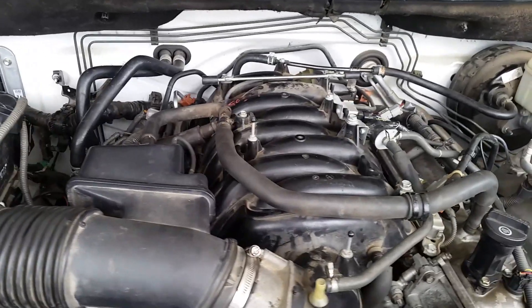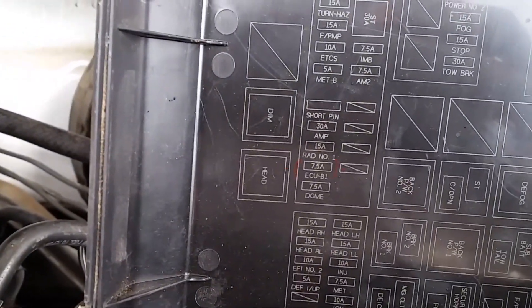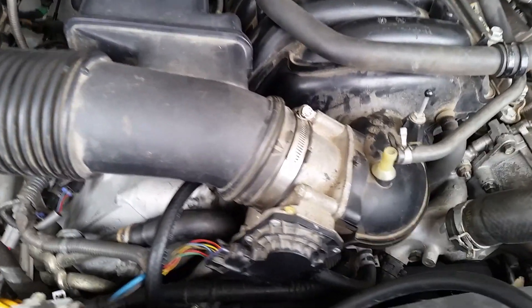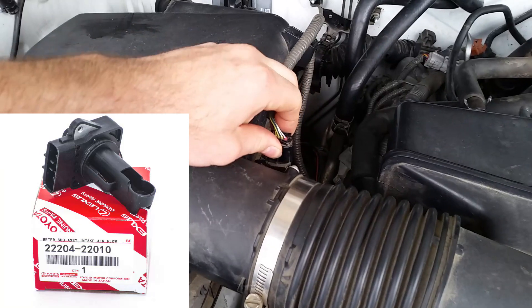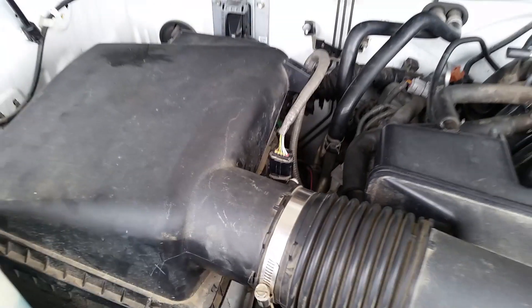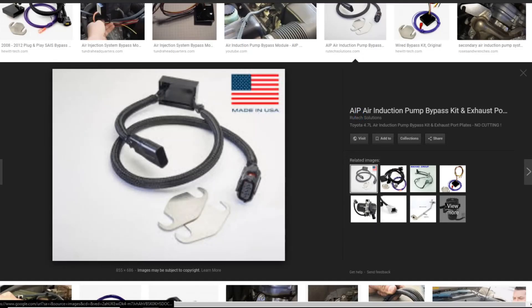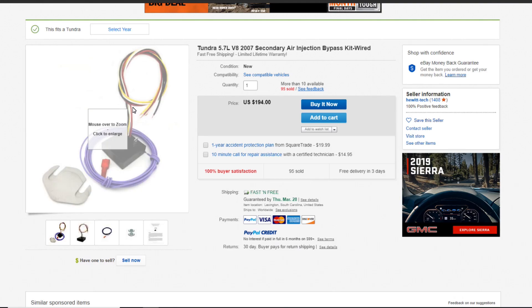I got everything put back together. You'll want to disconnect your battery post to help clear that check engine light, or another easy way is to remove the 7.5 amp fuse labeled ECU B1 — that'll clear your check engine light as well. Before your initial startup, double check everything: all your vacuum lines, hoses, throttle position sensor, MAP sensor — make sure everything is plugged in. One thing to note: there's a harness you can buy online that splices in between these two with a variable resistor module that fools the system so it won't go into limp mode. You'll still have a check engine light, but you can drive the vehicle. It blocks off the secondary air pump system and runs about $160 to $180 for that little kit.